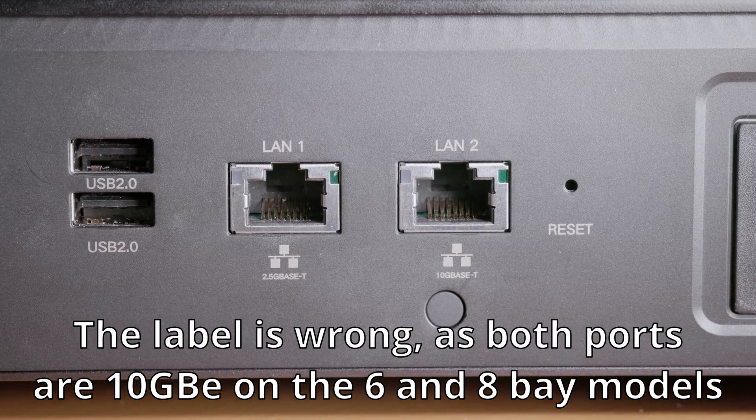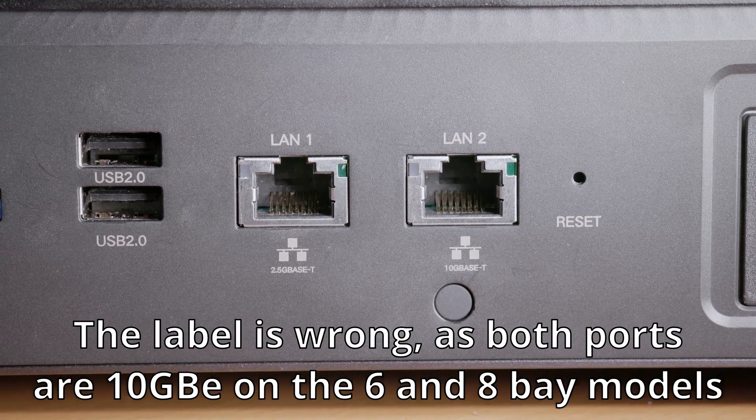When it comes to compatibility with the built-in OS, it's not great. If I put in something like an additional SATA SSD using a SAS HBA, it wouldn't be recognized in the OS UI, though it does show in the command line. When I added an NVMe SSD via the PCIe slot, it would contest for one of the two M.2 slots — with two M.2 drives and one PCIe NVMe, I could only use two of them. It did seem suited for network cards though, showing additional NICs alongside the built-in 10 GB ones as a total of four NICs. As for other OSes, I can use whatever card I want in this slot without any issues — storage cards and network cards both work fine.